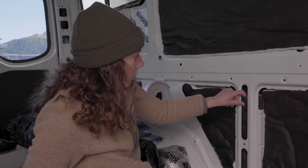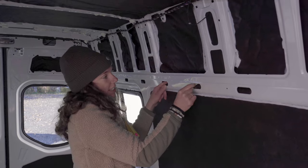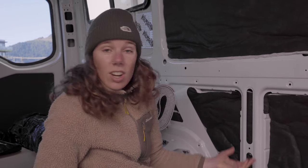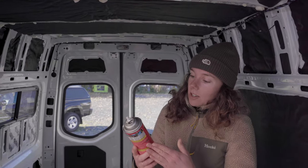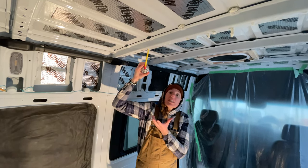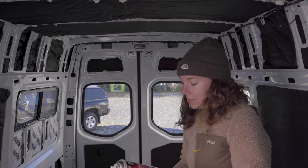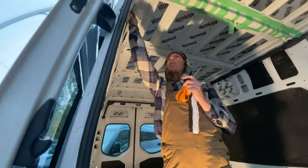Some pieces will require a little more shoving or navigating — for example, you'll need to use your fingers to shove a long skinny piece across. Again, this is one of the advantages of Thinsulate: you can really get into all those cracks. For a Sprinter, you will not be able to put Thinsulate in any of the ribbed supports. For those we're using Great Stuff spray foam, which expands and comes with a little nozzle so you can shoot it through all the little holes to fill those uninsulatable ribs. One tip: this stuff can get pretty runny, so once you spray it in, tape it so it can expand in place and doesn't drip out due to gravity.